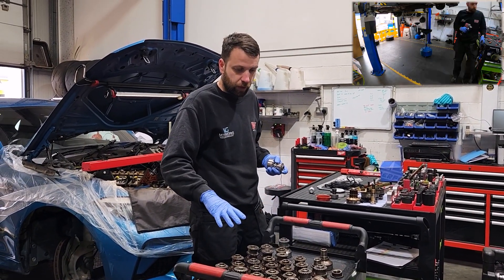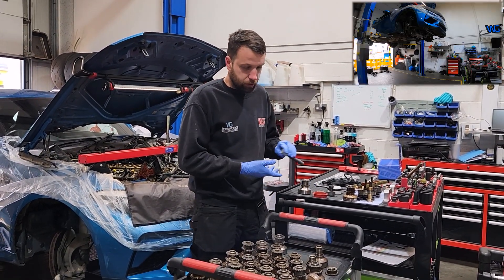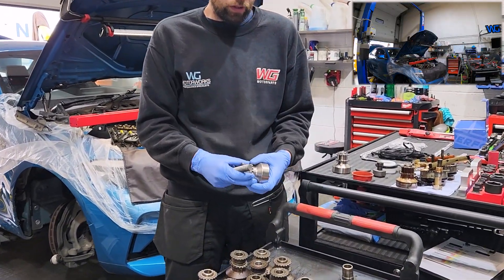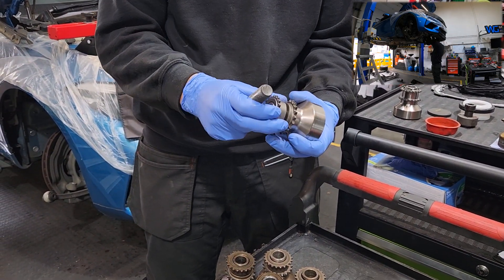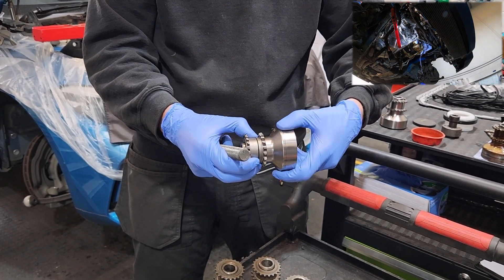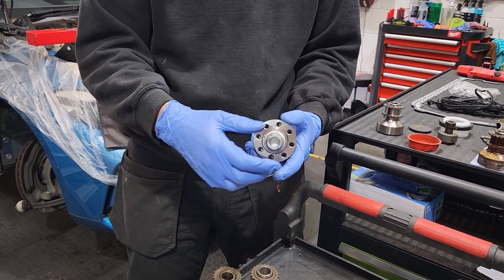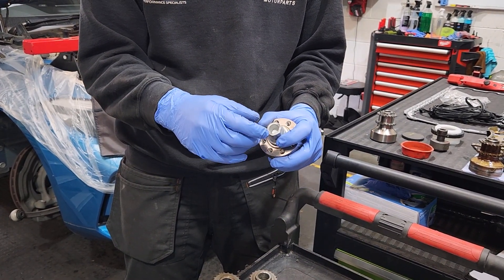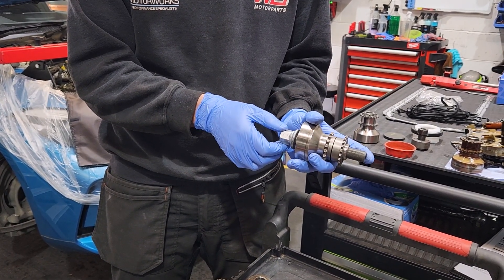You can see a little selection of crank hubs we've done over the last couple of years. With one of these hubs, it is a three-piece item — literally three individual parts. The nose goes into the actual crank itself, so it completely floats on the crank. Everything is down to bolt pressure, which is torqued at 100 Nm and 270 degrees. It takes about 500 Nm to actually undo these, so they are very tight from the factory.